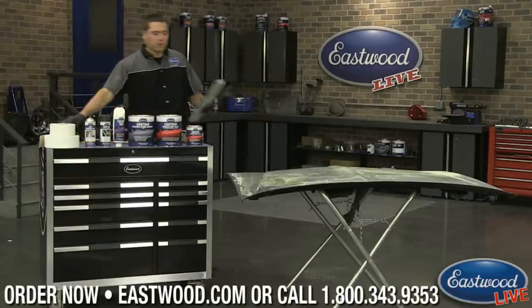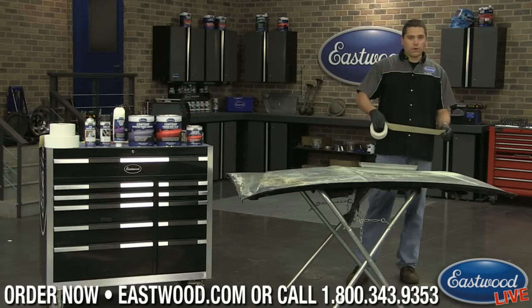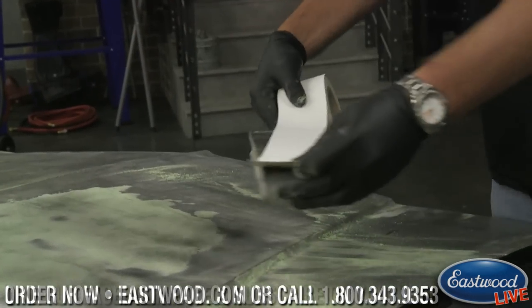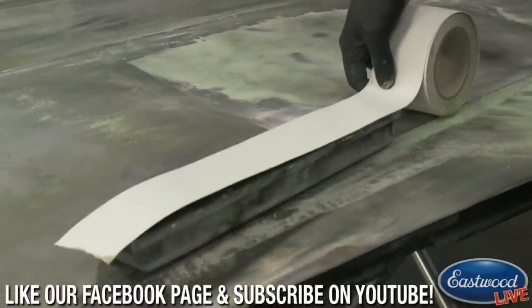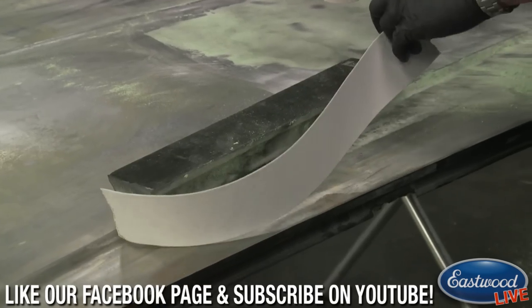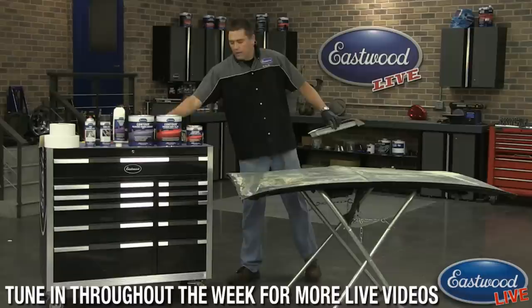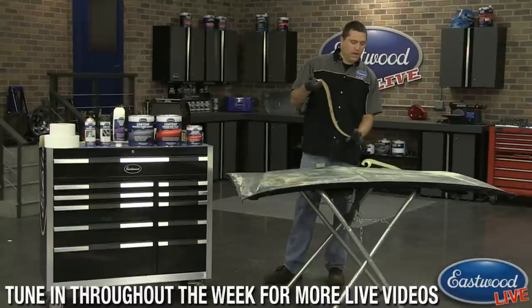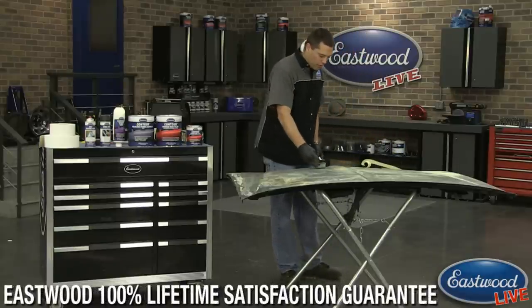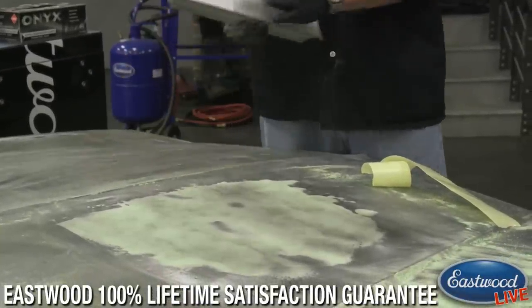So I'm going to swap over at this point to 80 grit, and I want to show something pretty neat. So with this paper, as Joe can see, you don't need any kind of special tools. All I ever do is just lay it out a little bit past either edge, and all you do is quick rip. That's it. And you're already ready to put it on. Now this does come with a protective backing on it, so you don't have to worry about wasting all your sticky if it comes undone or anything like that. You can tear it off ahead of time and set them aside if you want a whole bunch of pieces. And just set it on the block, and you know you're going to have a nice straight cut.